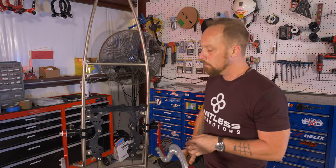So I'm gonna lay out a decent amount, something like that. And then what I'm gonna do, just kinda spread it around on the bolt. And as I said, as it comes into contact with metal, it starts curing. So thread this back in. Make sure your bushing stays on that little shoulder there, like that. And I'm gonna zip this bolt in. Okay.